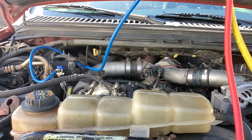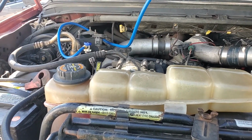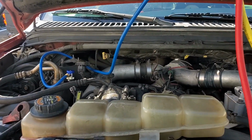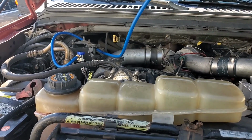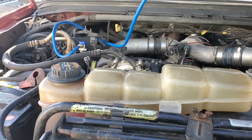So now that we've got that far with the diagnostics, I've determined that yes, it is in fact the compressor that is weak. So I'm going to replace it, and I'm going to be showing you all how to do that, along with, like I said, a whole bunch of other components. There's a sequence I like to do when I take the gauges off that will keep as much refrigerant in the system as possible and let as little as possible vent out to the atmosphere.